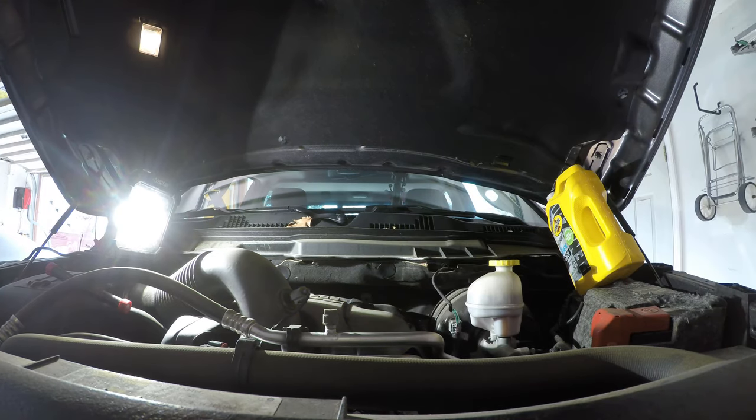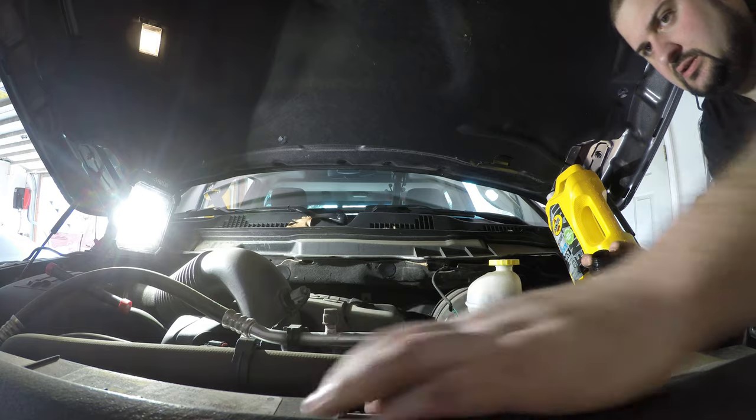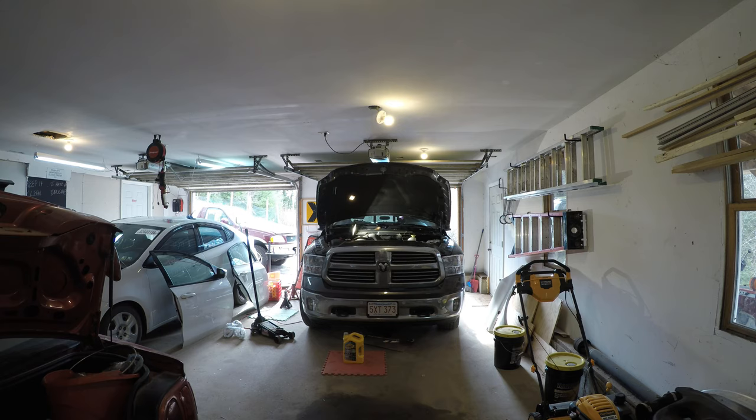Now we can put our fill plug back in. I can't find my bag of O-rings, but I'll put a link in the description and go back and change that later. Now that we've got the oil drained, the new filter installed, and fresh oil in the engine, what we need to do is crank over the engine a couple of times to make sure the oil flows around the system, then start it up and reset the oil life counter. I crank it a couple of times without letting it start, just to prime the system a little each time, getting a little longer.